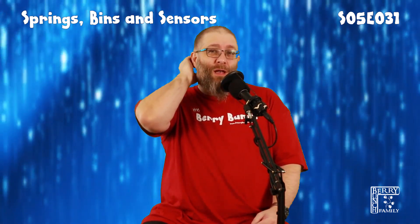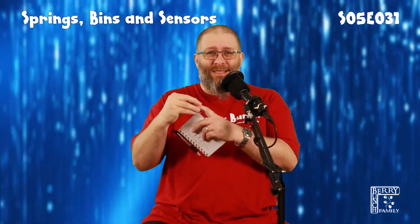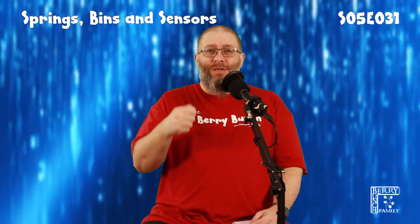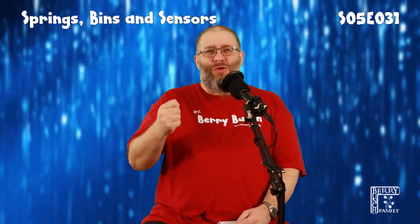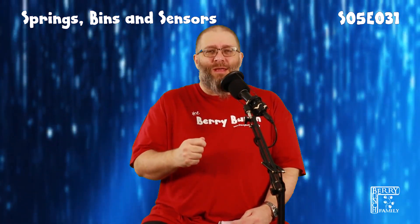So I took it apart and I fixed it. I glued it. I strengthened this little sheath thing that the motor sits inside so that when it turns, it didn't split and break — that was the funny noise we were hearing. Used some cable ties, super glued those on, cut off the ends. It all works perfectly now. But I took out a spring — we don't need the spring, I don't even know what it was for.